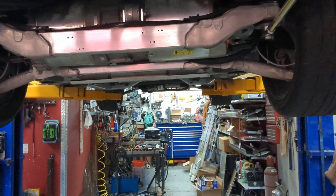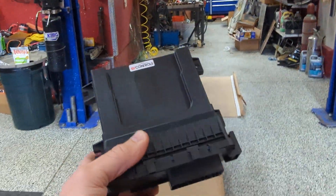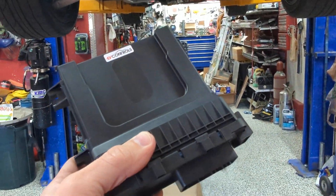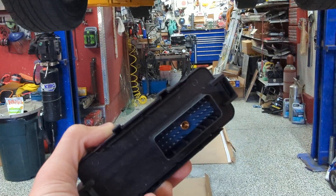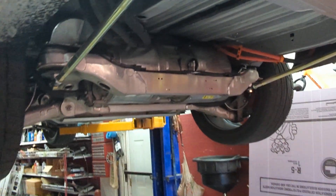Now I'm using the factory Tesla control board inside the inverter. But then I went to an intermediate device — this is from EV Controls, called the T2C. It uses the factory Tesla tune and control board, but it's an intermediate so that I can interface with this car, and it uses CAN bus communications to do that.